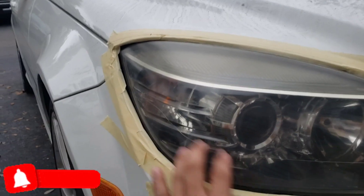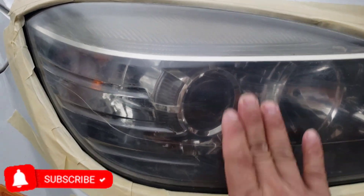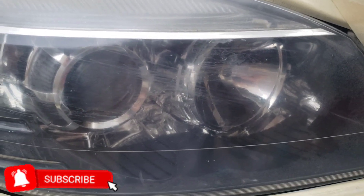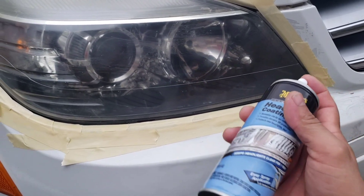Make sure it dries — the acetone dries pretty well. Let it dry for about five minutes or so, depending on the temperature. See if you can see this one's got some scratches in there that if I don't remove will show. I'm gonna clean it a little bit more to take care of those. A few minutes have passed, now it's time to spray.